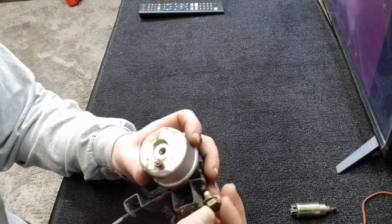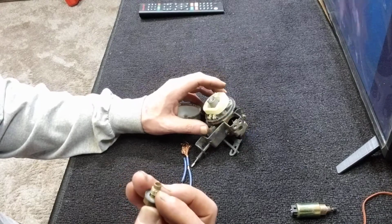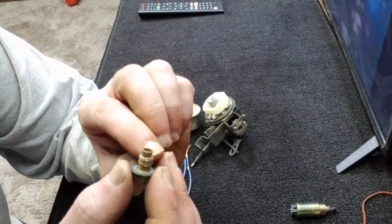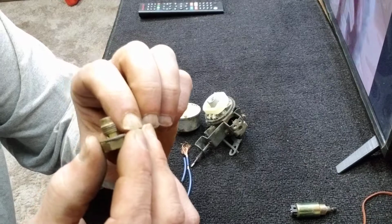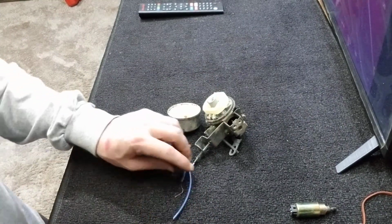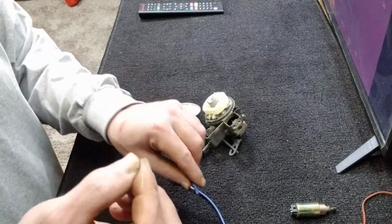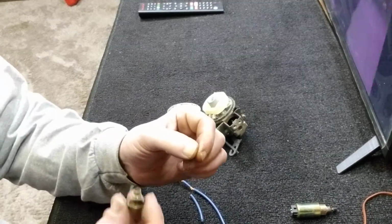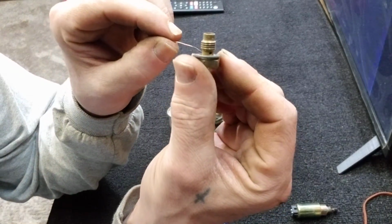And I don't really know all that much about how carburetors work, but I do know there's jets, and jets are just little tiny holes. This one's got 3 holes in it, if not more, 4. I don't know if you'll be able to see them. They're frigging tiny. So what I do is I took a wire, stripped the wire down, pulled out one single strand, one little strand out of a wire. You can use that to prick through these little holes.